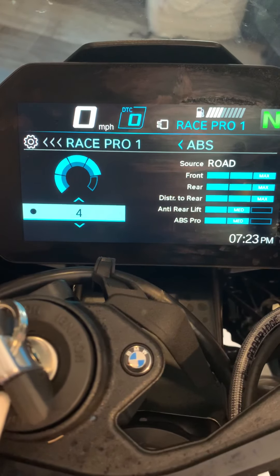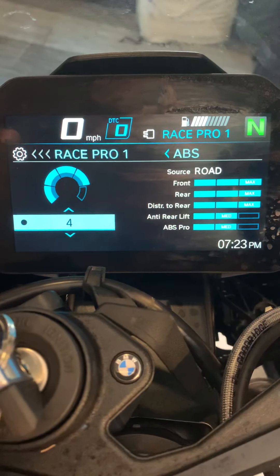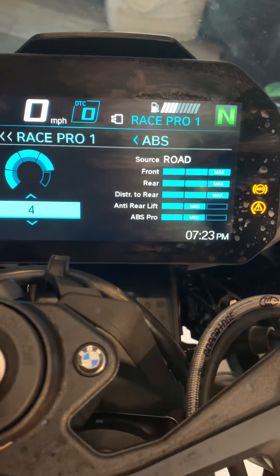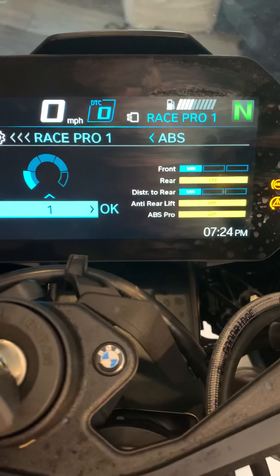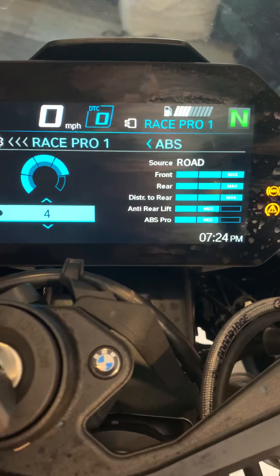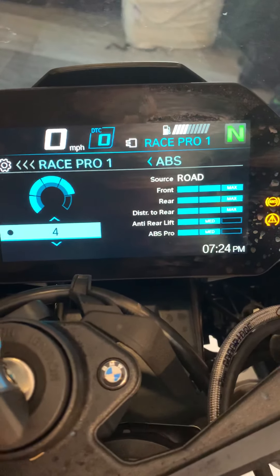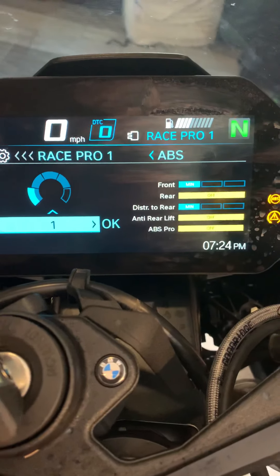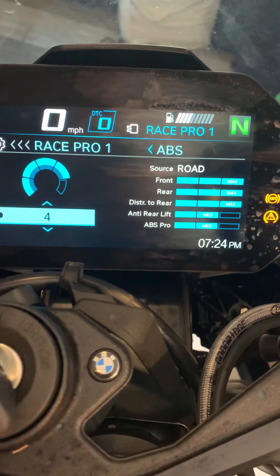ABS - again I don't know enough about how much of a difference the settings make. I've yanked on the brakes at high speed and it squirms all over the road, just like my old bike did. I haven't gone through all my settings yet to see if setting number one - which is basically a track setting - is something I'd prefer, with ABS Pro and anti-rear lift on. Now, one thing about the S1000 is that when you touch the front brake it also does the rear brake - so it's all integrated. You can turn that off; if you go to setting one you can see the rear brake is completely separate, which I suppose is where you'd want it on a track. For the road, I'm keeping it on the integrated setting until I know more.